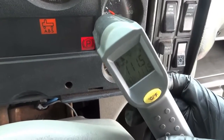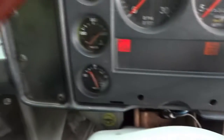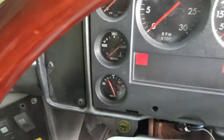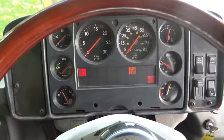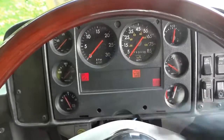I'm back inside the bus. Here is the actual engine temperature: 111.5 degrees Fahrenheit. While our engine temperature gauge is showing 260. So our engine is not overheating. The issue is probably the sensor, the wiring, or the cluster module itself.